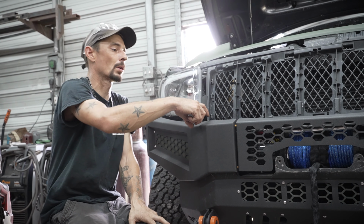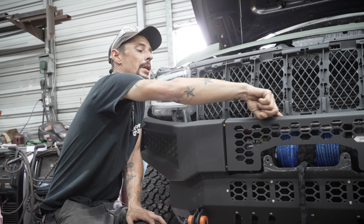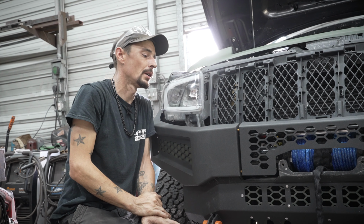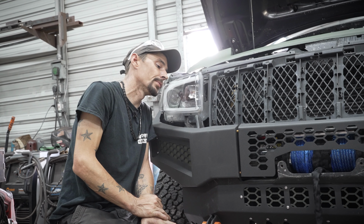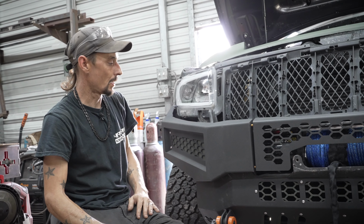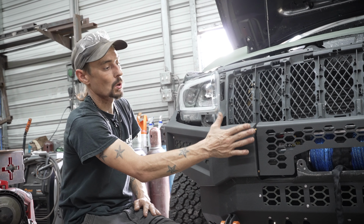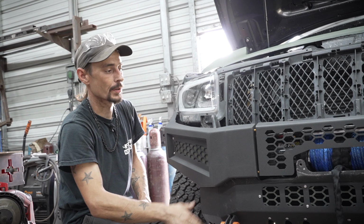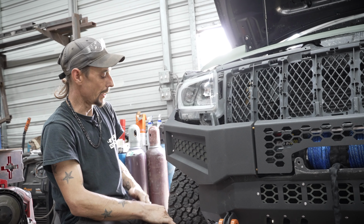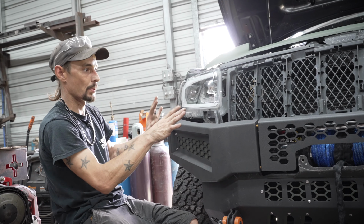We've gone ahead and marked this inner plastic. We need to trim a little bit more off of this 11 to 13 fascia. So we'll trim that off, and then we'll remove this entire section, apply the upper. We're gonna bolt this all together separately when it's off the vehicle, get it all tight, and we'll be able to put the entire thing up there as one unit. And then we'll be able to work out the inner bracketry to get everything to set perfect.